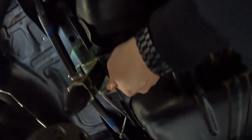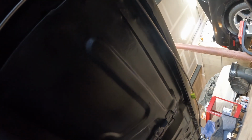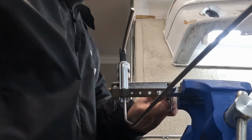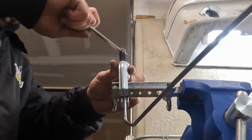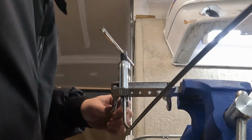Now this, I'm gonna have to just adjust, but you can see where it's supposed to connect over there. It's a block to this, and then these two should be good. And over here, it comes up over here, clears the parking brake line, comes down over here under this, over to here, where we will complete our union. This tube has to come out, and then I have to flare it, get the big hose out, get this as tight as I can get it, and yeah, so we're going to try to flare this one down to the shoulder. Let's just tighten this up one more time.